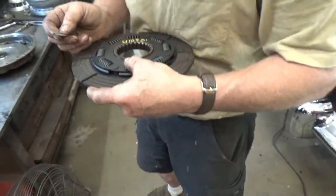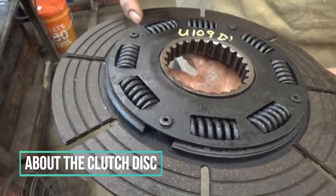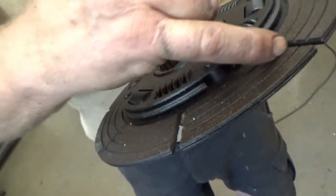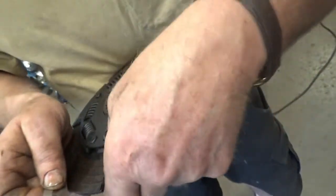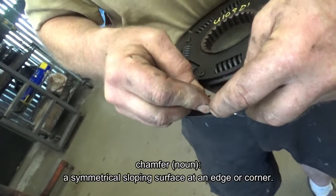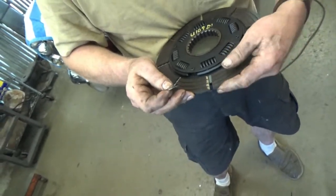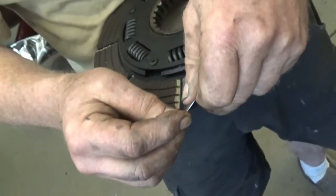Don't drink the Packard Kool-Aid, whatever you do. But you will notice that they've cut the slots here like they should have, and they've cut the grooves like they should have, because that allows the oil to get off of the surface as the clutch engages. But there's one other little thing that needs to happen — we're going to take a razor blade and cut a little chamfer onto here. Chamfer — C-H-A-M-F-E-R. And you might well ask, why do we want a chamfer here?